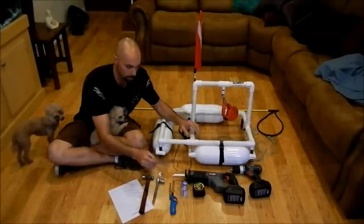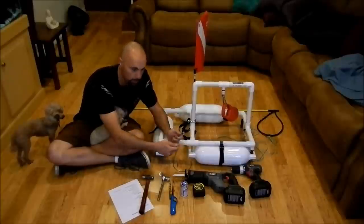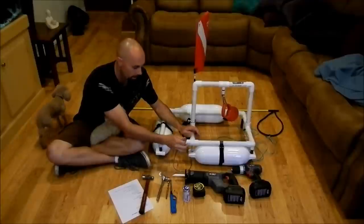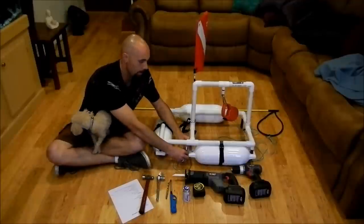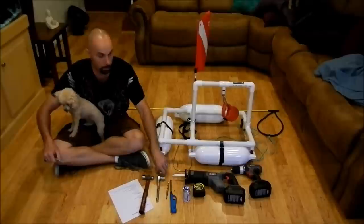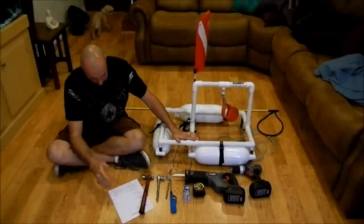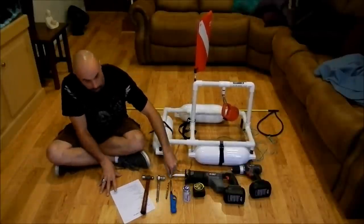So I took my 3/4-inch socket, which is what the head of the bolt is, I put that socket on my power drill, and I drilled it into this T connector, causing it to make its own threads. And then I took the socket wrench, the ratchet wrench, and screwed them in gently, just snug enough that it holds with the washer, so that it holds the bumper up onto the frame. Oh, and the head of the bolt is marked FH, if that helps. Got everything at Home Depot.